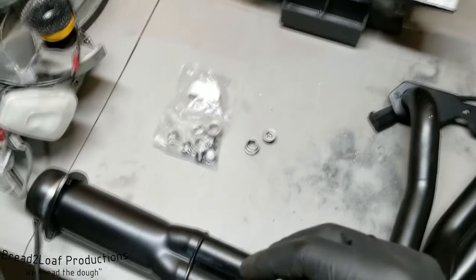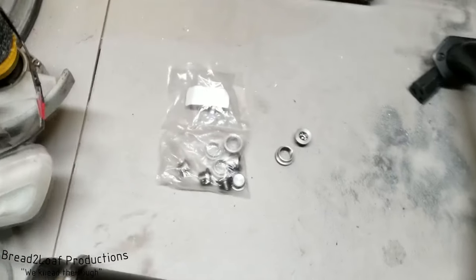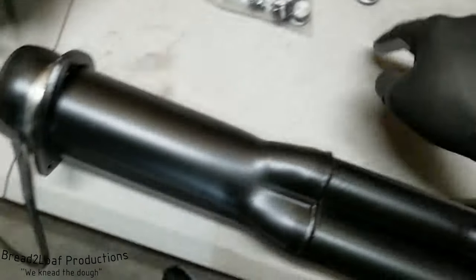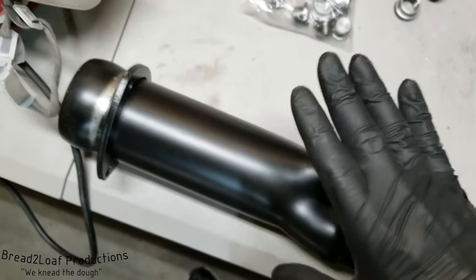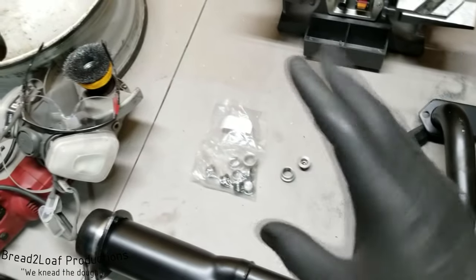And additionally, we're gonna be putting an EFI system in the Lance in an upcoming episode. So stay tuned for that. And in preparation for that install, we are gonna be putting in O2 sensor bungs on the collector pipes as we're doing the headers. So this is gonna save us a lot of hassle later on because we'll already have that done. And that's a necessary component for your EFI system.